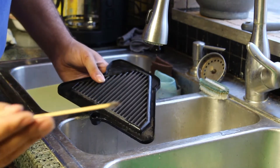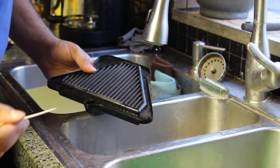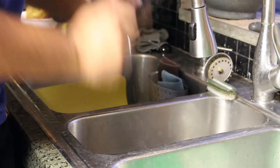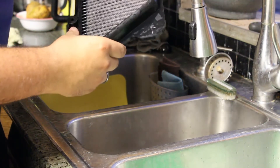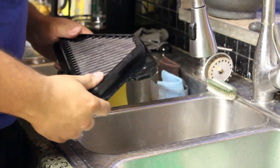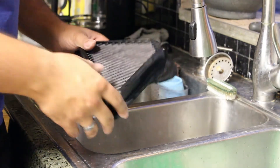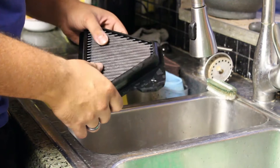There's really some nasty stuff that's stuck in there, so just go through each plate and make sure you dig out everything that you can. I just finished rinsing this out. After picking through everything I just rinsed it out one more time. Now you just want to shake any excess water out of it. Do not blow pressurized air through this because you could damage the filament — this is supposed to air dry. Depending on temperature it may take three or four hours, or it may take just one or two. Probably good to just leave it to sit overnight. I like to set it on a chair in front of a fan with the fan blowing on the dirty side. Once it's good and dry, then you can apply the lubricant.